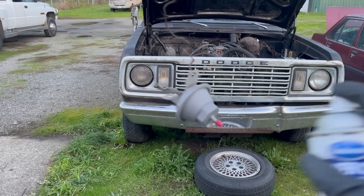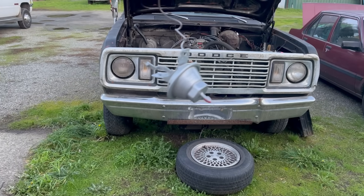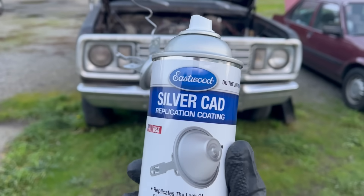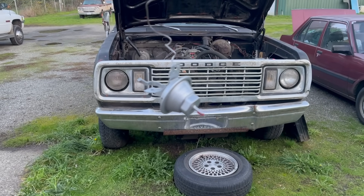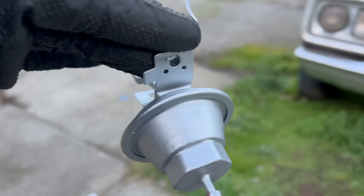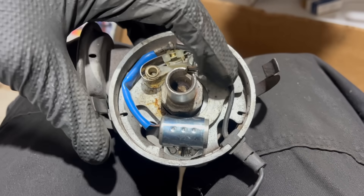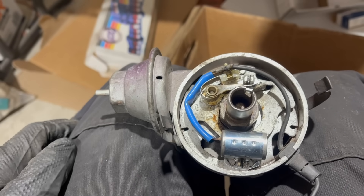Had to do it — couldn't leave the vacuum pod ugly. Now, these parts are actually supposed to be plated. Recently we got some silver cad look-alike spray paint. It looks pretty good — you're supposed to do it in three thin coats. That one was not thin — that's my bad. But if you get it right, it gives you that nice powdery finish that the coated parts would have. Now I'm going to use the actual plate assembly out of this distributor: for one thing, I already put new parts on it, and for another thing, it looks a lot better than this one.